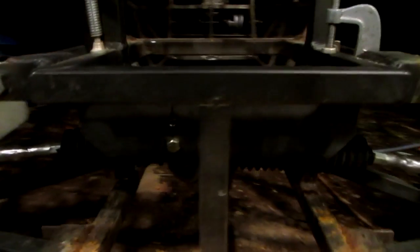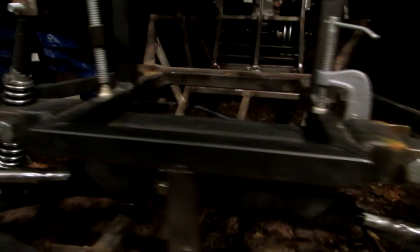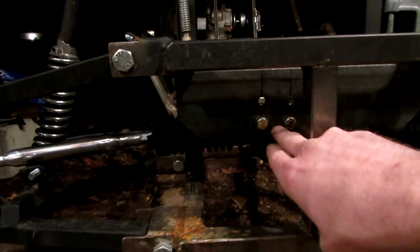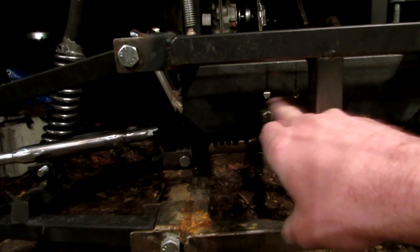Okay, so let me show you what I did here. What you see right there is a big old chunk of three by three angle iron, 3/16 thick. Couldn't get it in 1/8 — that wall thickness doesn't come that thin for that size of angle iron. I offset the mounting bolts since the rack and pinion bolts are a little offset, and measured it down and then drilled the holes. You can see my first screw-ups right there.